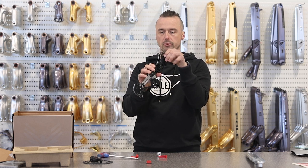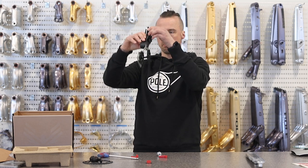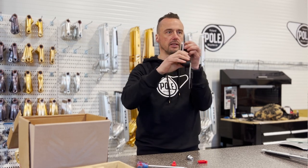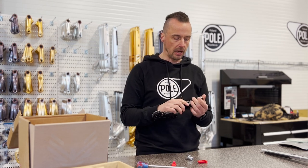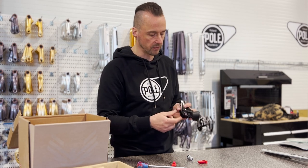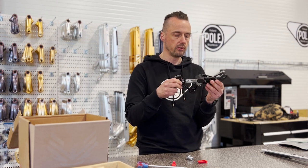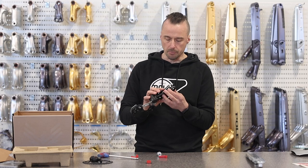This side, when you put it in, works as a support. The biggest problem with larger-axle derailleurs was that when you hit bumps it kind of wants to twist side to side because you have the swinging mass and at the same time you're kicking into gears. It kind of bent some of the derailleurs, and the cages were bending and the small pins were undoing themselves. So they've addressed quite a few things to improve this, and I think these improvements are very welcome.